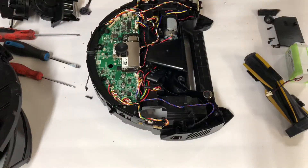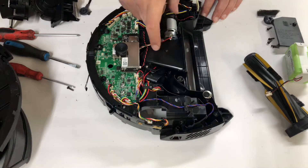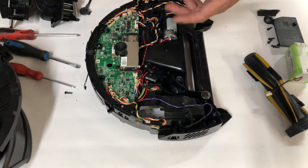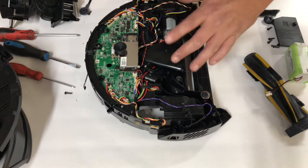Flip it over so you all can see. There are two reasons for a grinding noise when your robot is running. The first one is the main brush roller — the IQ has a sensor in there in case the amperage or temperature goes up, so those don't fail as much. But we do get grinding noise from the suction motor. If any sand gets in there, it will cause the bearings to wear out, and just wear and tear in general will cause it to grind.